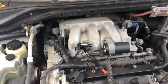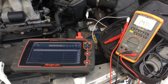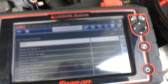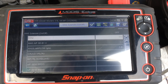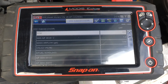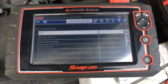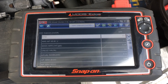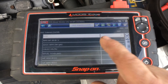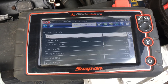The code I had was P1800. I'm fortunate enough to have a scan tool — it's a Snap-on Modis Edge up here. My first step was to use the scan tool to actually activate that solenoid manually. What I'm going to do now is put the camera facing the VIAS actuator and, on the scan tool, activate that so you can see what it should do when the solenoid is actually activated.